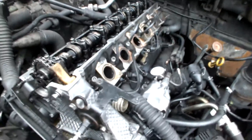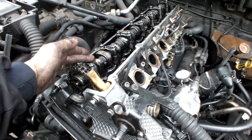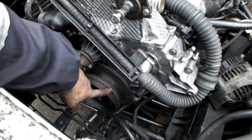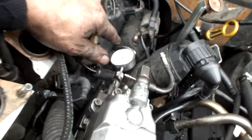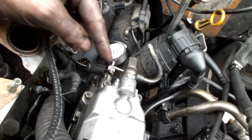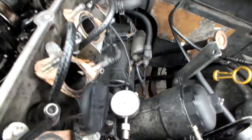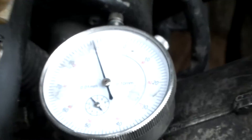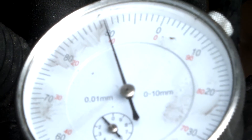Now I'm gonna spin you around and as you can see we've got the cam top dead center. We have the crank on top dead center and at top dead center the pump is adjusted, as you can see — you get a better view of it over the top. See if I can zoom in. There you go. Perfect readout.